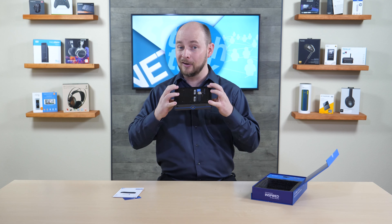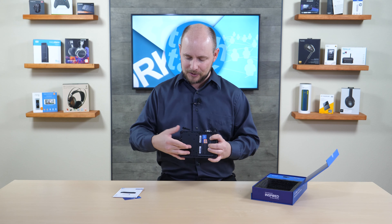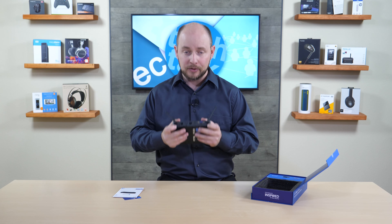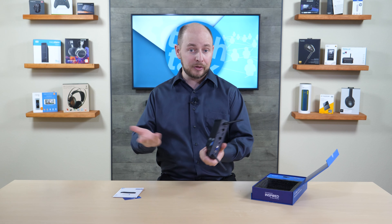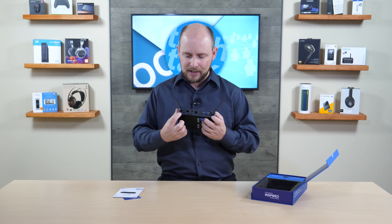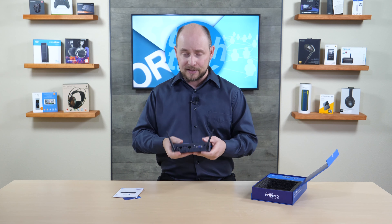To open the unit, there are four corner screws and the four rubber feet also function as screws — no hidden screw under a sticky pad, the feet themselves unscrew directly. You remove the feet and the two bottom rear screws only when you want to upgrade the memory from 4 to 8 gigs or add a 2.5-inch or NVMe drive. If you're not upgrading, leave it alone.